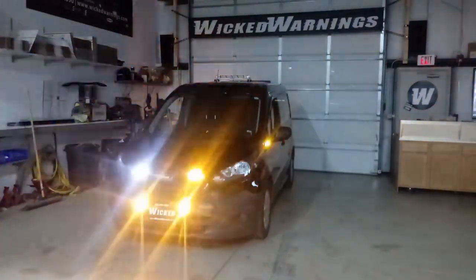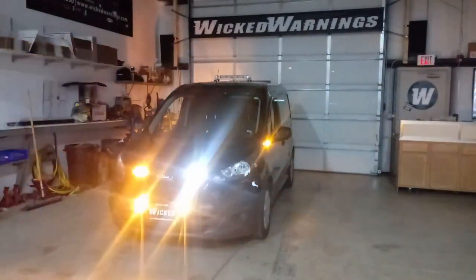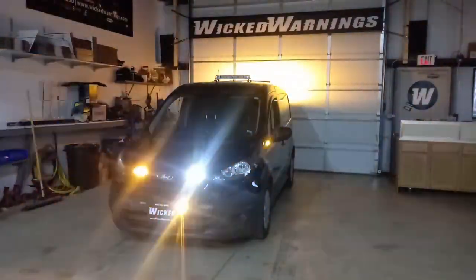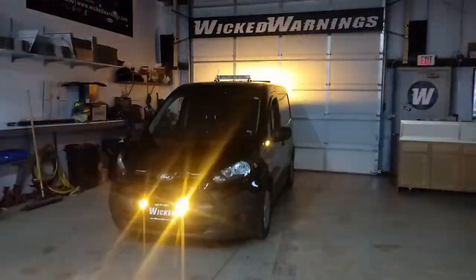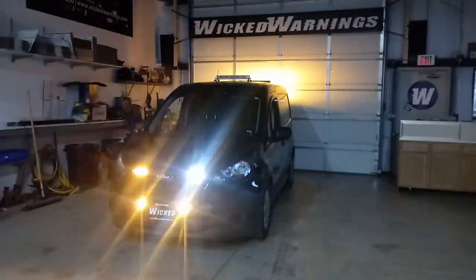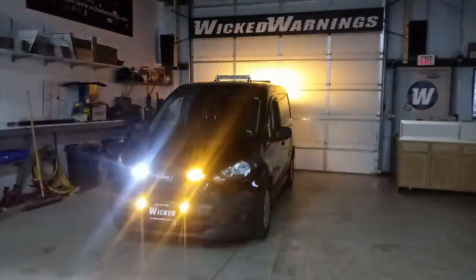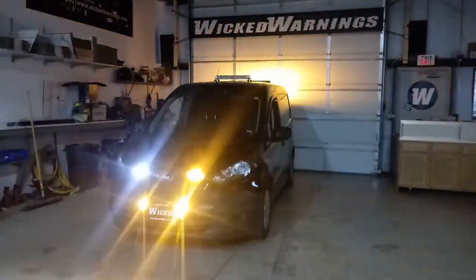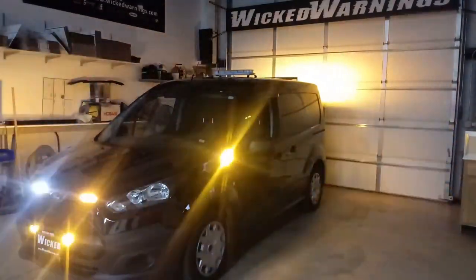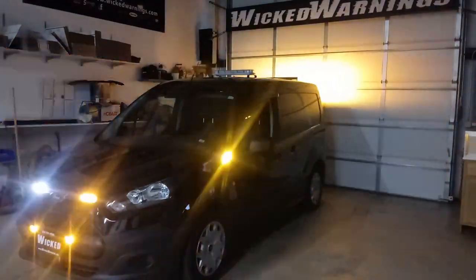I did this to give him an option to have no white other than the two in the grille, and then he could add white in if he needed it. So for instance, when he turns on the Wicked Stick in the rear, you can see by the reflection on the door that it's all amber. He can have his front light bar, his rear Wicked Stick, and most of his corners running all amber — the only white in this mode is the two whites on the top of the grille from our Razor. Forward-facing white is never really a big deal; it's when you get white facing the rear that you might want it on a separate switch, which is exactly what we did here.